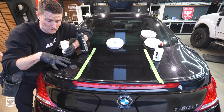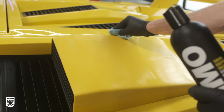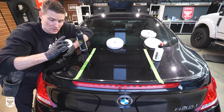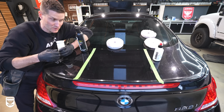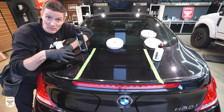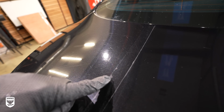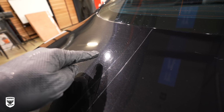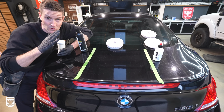So in section 1, here's what I'm going to do. Normally, I would use skin. Now skin is a sealant and there's no restorative or abrasives in there, but I've been playing, because I'm a crazy person, with what we call a cleaner wax. In this case, it would be a cleaner sealant. So the way it works is I would use a foam pad, which I'm going to do, and I'll show you. Go through a couple of passes. It's going to make the paint look much better, meaning it's going to remove a couple of the swirls. If everything, like on this side, no, but it's going to be incredibly fast. Now, the interesting part is when you're done, that's it. It's got sealant on it, meaning you've done 2-in-1 steps. Very, very quick, a couple of hours in your driveway and you're good to go. You can do it by hand or machine.